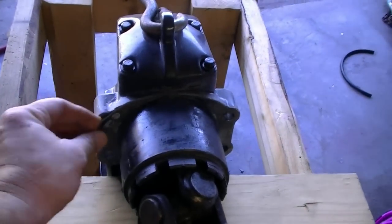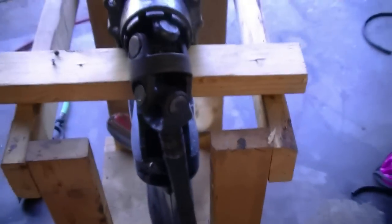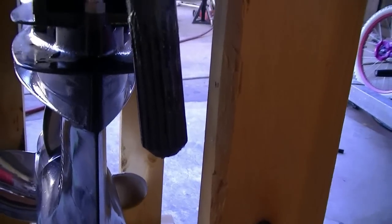It's actually this gasket right here. It comes with two new O-rings, so you should replace those every season. But you can see that the grease is still nice and blue. There's no weird stuff going on with the splines here, no rounding. That's another big thing you need to make sure of, is putting spline grease on here to keep the coupler and the engine happy.